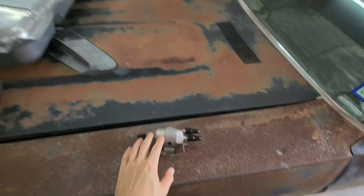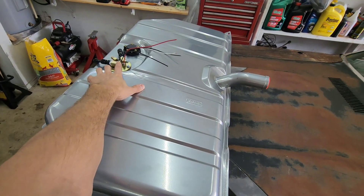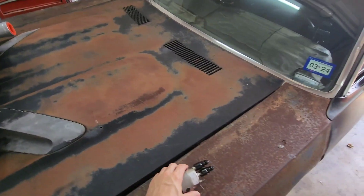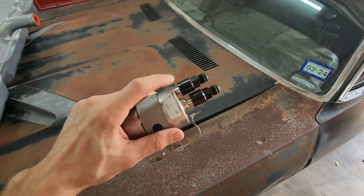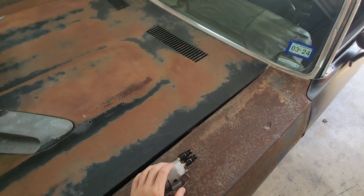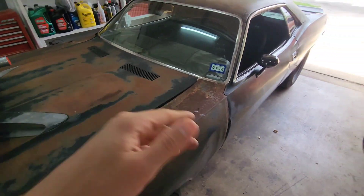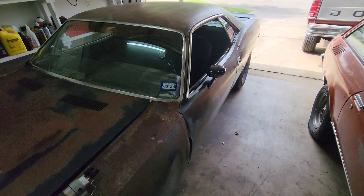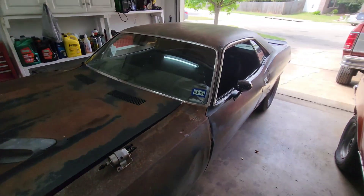If you're using this unregulated pump setup, you've got to have it regulated at 58-60 PSI — that's what this filter regulator does for you. Make sure you run your return line when using these; don't cap it. I learned the hard way that capping it messes up the whole fuel pressure for the engine. But that's it — super simple.